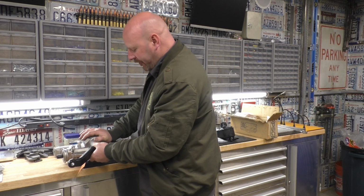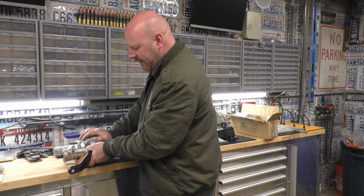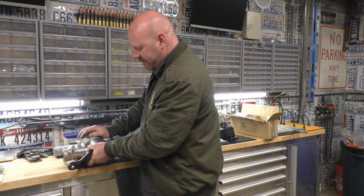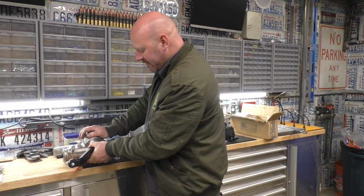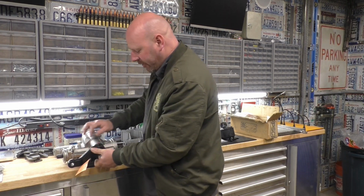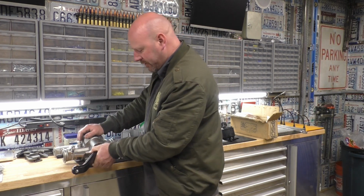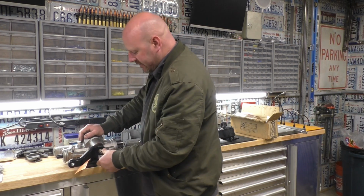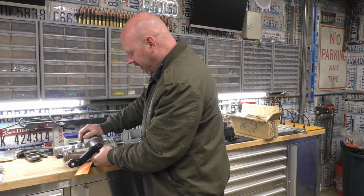So now we're infinitely adjustable. You just have to pay a lot more attention when you're putting it together, is all. That's the only reason they do that, is just so you stick it on there and it fits. But it doesn't make it any weaker. You still have every single spline engaged. You just have a groove in the middle there that wouldn't do anything anyway. So it is still good. We didn't compromise it in strength at all.